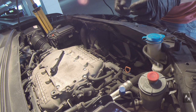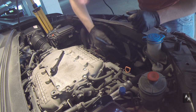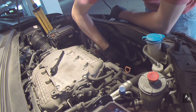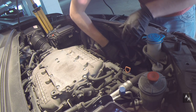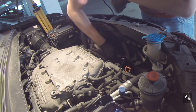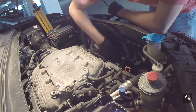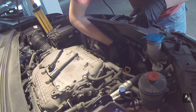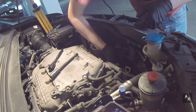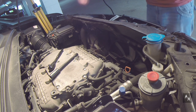Next step is spark plug removal. Using a 3/8 inch ratchet and a 5/8 inch socket, insert it into the spark plug well. Secure it over the spark plug and turn it counter-clockwise. You should be able to easily remove the spark plugs applying medium force. I'm also using a cheap spark plug tool with a floating hat and a rubber attachment for extracting spark plugs.